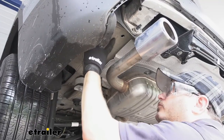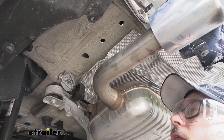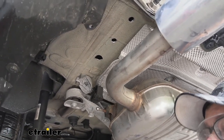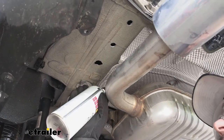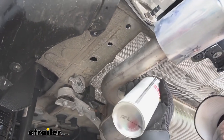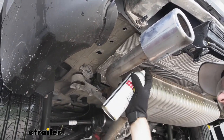You can see our three holes drilled out and the one enlarged hole as well. Now it's never a good idea to leave exposed metal underneath your vehicle — it can cause rust and corrosion. So I'm just going to take a little bit of clear spray paint, go hit these, seal those up a bit, and prevent any rust and corrosion down the line. I'll do the same thing on the other side.